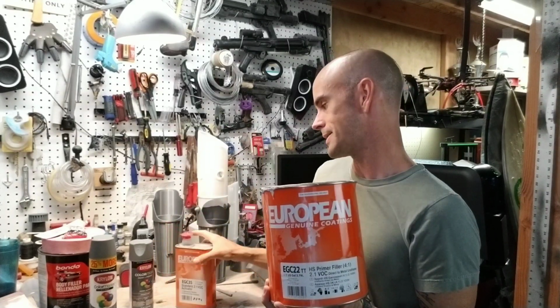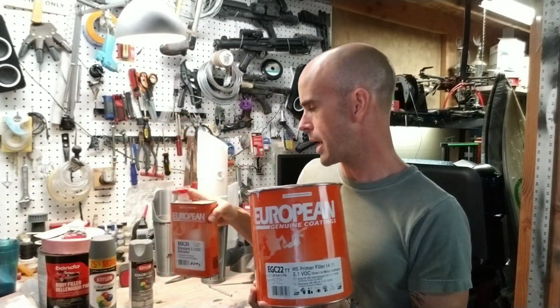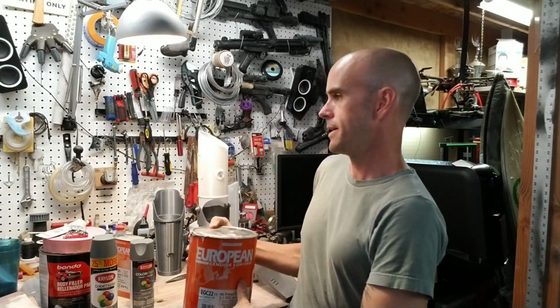But I'm about to contradict myself because recently I've started using 2K Auto Primer, which comes in a can and it is cured with a catalyst. So it's a two-part primer. You have to spray it through like a paint gun, and it's awesome.